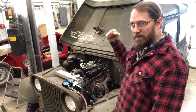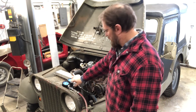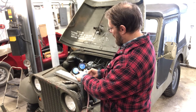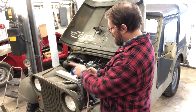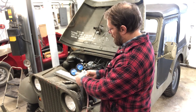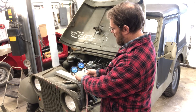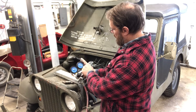Now what we do is increase the pressure here until I get to 100 PSI, and then look at what I've got on the other gauge - that tells me the percent of leak down. I'm at 100 PSI here but I'm only holding 35 here.